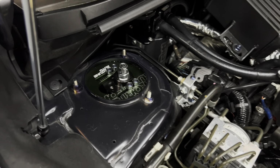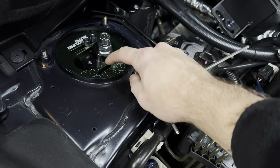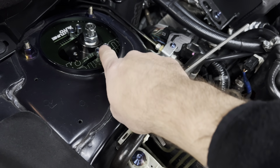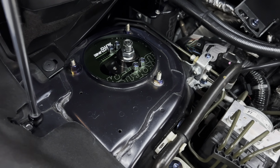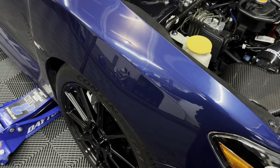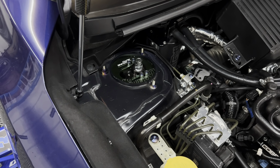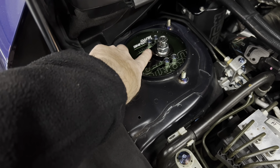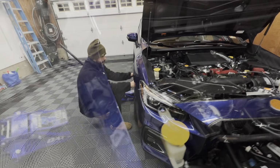And if you guys are wondering, the camber bolts that I'm using are from Titanium Works. They're titanium. The little sleeves that they're slipped into, the silver, are from Fortune Auto. So the bolts are from Titanium Works, along with these strut nuts as well. But what I'm going to do now is grab the actual wheel and pull it back, and you'll see the camber plate move. I'm just going to dial it in right to the 5th notch, or the notch right before the circle right there. So let me go ahead and do that, and then I'll show you what it looks like.